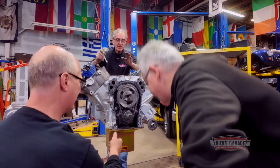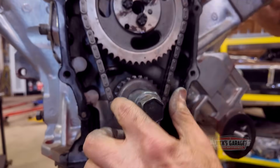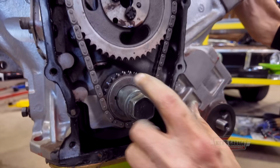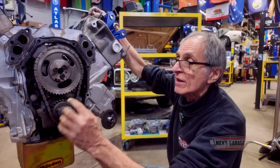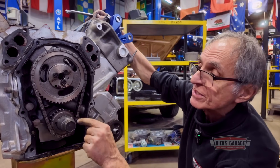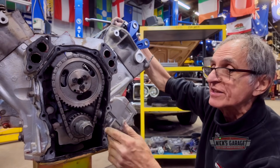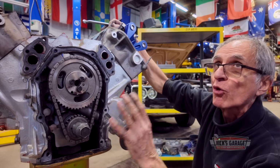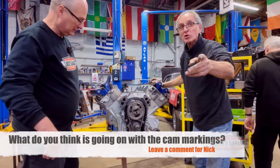Thanks, man, you're so hard. No, it didn't start. This is good. May I say something? Sure. When you use 4 degrees advance or 4 degrees retarded, because this is what the other two markings are for, this may be slightly off. But it's on the 0 mark. Those lineups should line up 100% straight, a straight edge right through. They are not. There's something wrong here. That's all I want to tell our viewers. You tell me your opinion, guys.